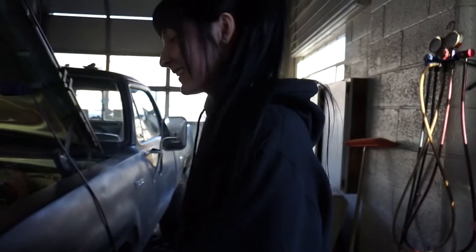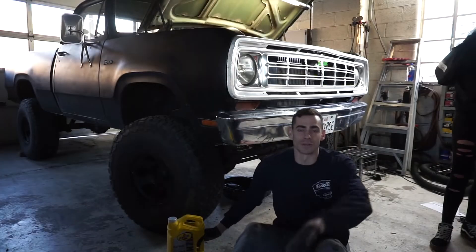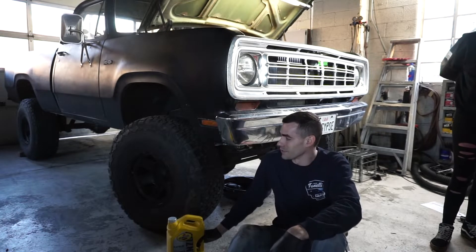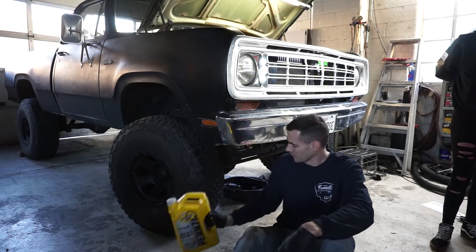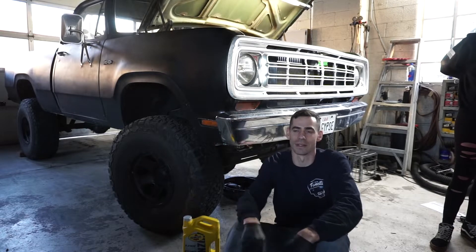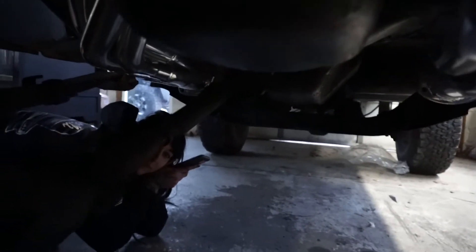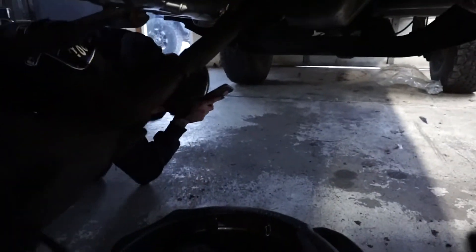Go celebrate — go get some Arby's! Excited! Now that it's running really good and sounds good, cranks up on the turn of the key — which is really nice — oil change time. Let's get underneath this thing, pop that drain plug, let that old oil drain out. We just dropped the oil and the last little bits are draining out into the pan. It was looking a little dark; it had been a minute since it was changed, so it's a good thing to do.